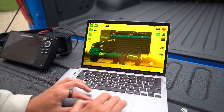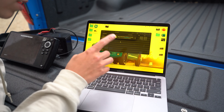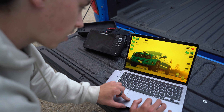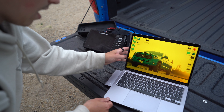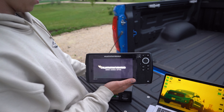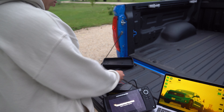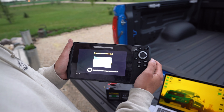Right here, we are running version 2.0, so that is older. Click here, continue to update. Now it tells you this is the latest update available, and underneath it has some new features — a new base map, some general fixes involving the system, the sonar, etc. Underneath it also has step-by-step instructions. Because there are two steps — Download Helix software, and a new Humminbird base map — we are going to start with step 1. Click on it and now it is going to go into the download bin. Wait for it to complete downloading.